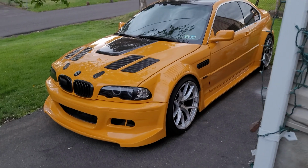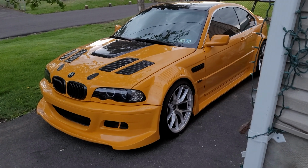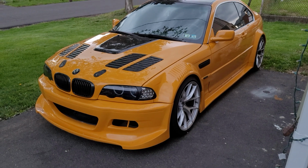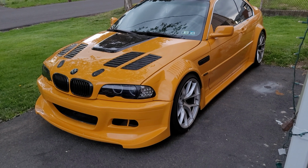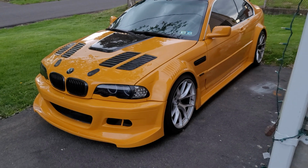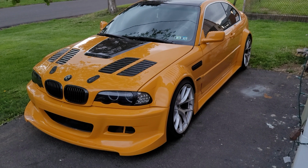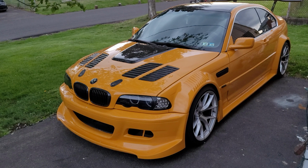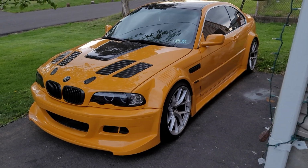It's really hard because of bad weather and work and baby and everything, but I'm currently in the process of finding the new motor. I think I might just go on Copart, get a hit Corvette, so I have the transmission from it and the engine that I want. But so far I'm looking locally for truck motors, 5.3s, because they're really cheap, and then just slapping it with a T56. I would really like an LS3 in this car. It's just those are extremely popular and expensive right now. Even the truck motors are going up in price, so it's a waiting game.